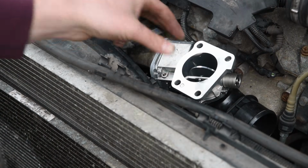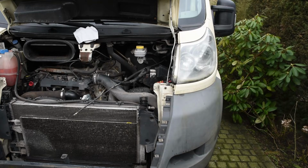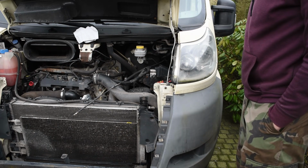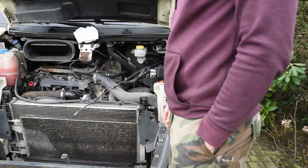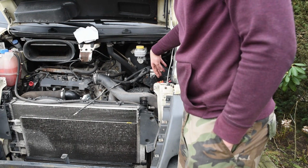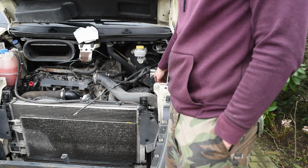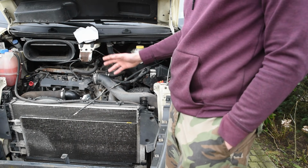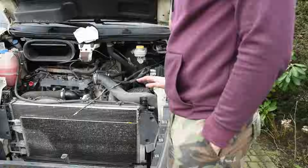After fitting the part to the engine, it didn't do anything. Okay, so I'm temporarily gonna give up on the throttle body issue. It would really surprise me if it were broken, so it still could be a connection. I've checked fuses. There is no separate fuse for this throttle body. I also measured, and it does get 12 volts. So I'm gonna leave it at that.